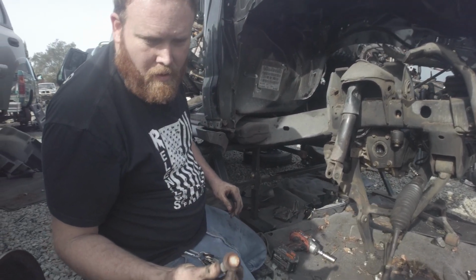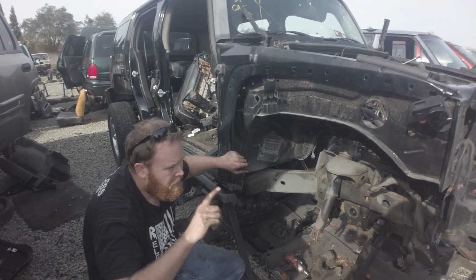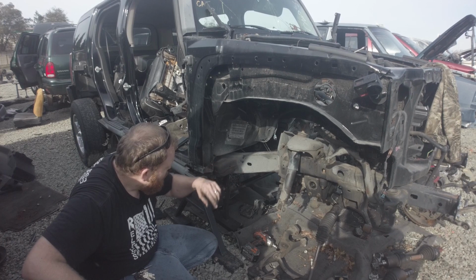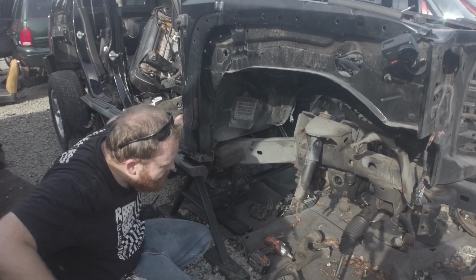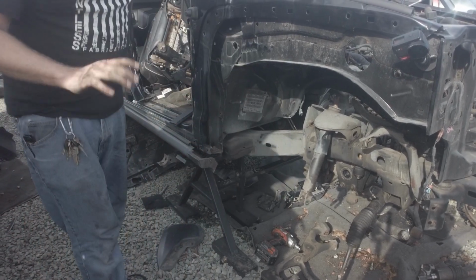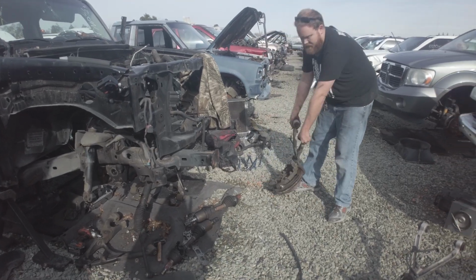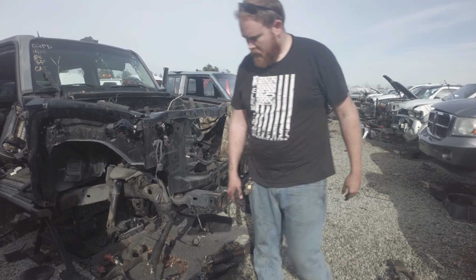That's why you grease the inside of your torsion bar sockets. Other than the sway bar, we're done with the front suspension, but I do want to take that axle, so I need to undo the diff bushing and all sorts of stuff. So pull out the parts I need out of the way, and then we'll drop the diff. Control arm.